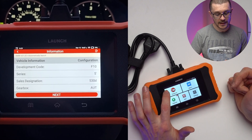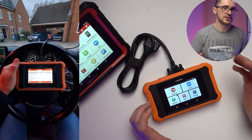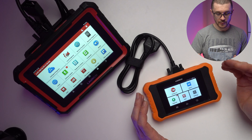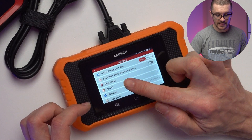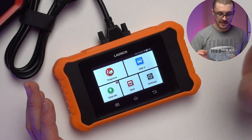When connecting this unit to the vehicle, you'll also see the battery voltage in the corner — make sure you're not going too much under the 12-volt area. One piece of advice: pair your diagnostic unit with a hotspot on your phone for moments when you need to do diagnostics and the tool needs an update or wants to connect to the internet. Also go into settings and deactivate automatic detection on connection.